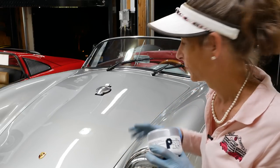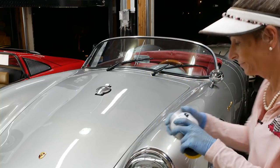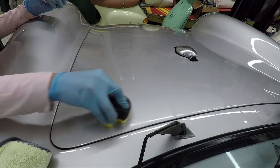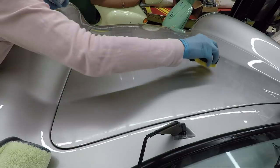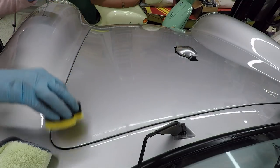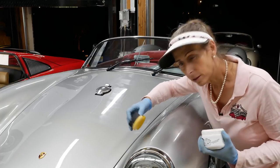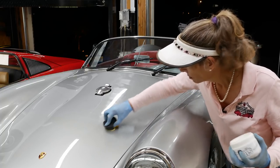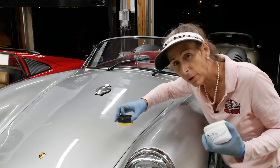Stuff's great. You pretty much just coat the whole car, wait for it to set up, and then you just wipe it off. It's a pretty simple wax. If you have a clear bra on your car like this one does, you want to make sure you don't wax into the clear bra and back onto the paint — wax in this direction. That'll help keep buildup down. It won't be nearly as bad as if you went the other direction.